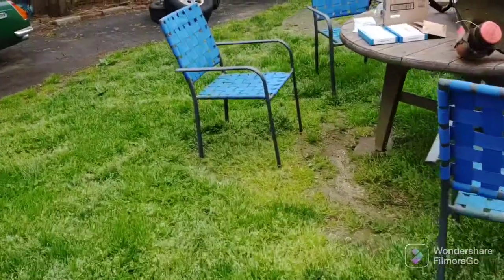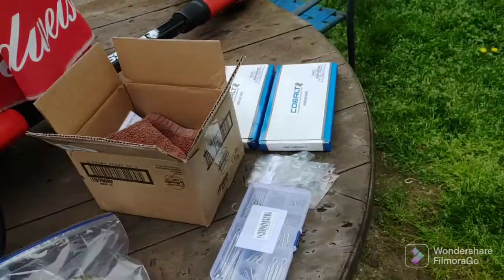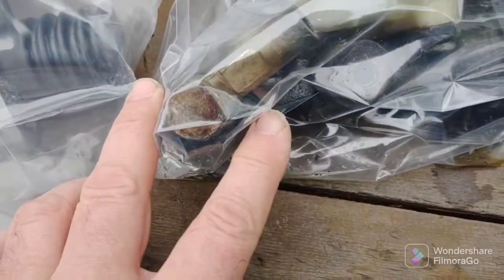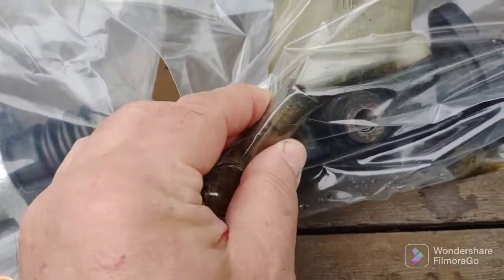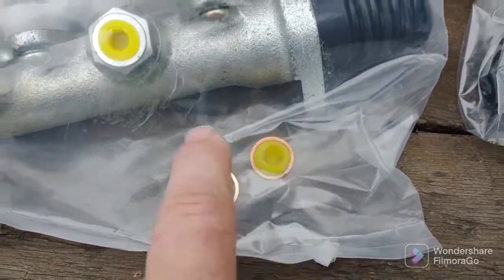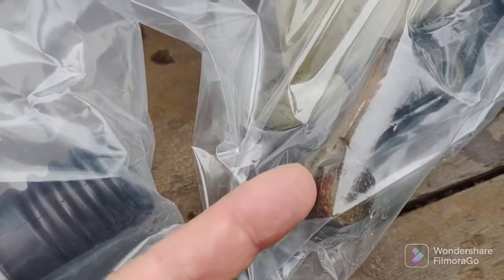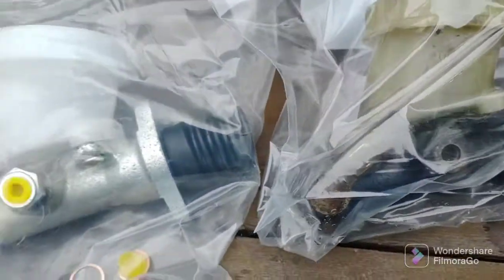I have to go to the hardware store because I'm missing some hardware - bits and pieces that previous owners or mechanics didn't put back, like a bolt here, a lock washer there. Here's the old master cylinder. I have to take off this banjo bolt and fitting and put it at the same angle on the new one. There's supposedly a valve in here we have to transfer from the old one to the new one, and two copper washers that go on either side.